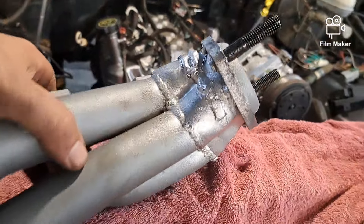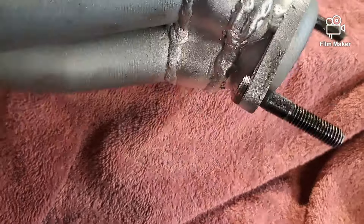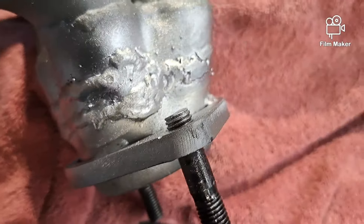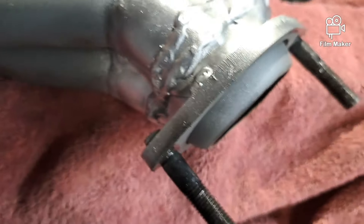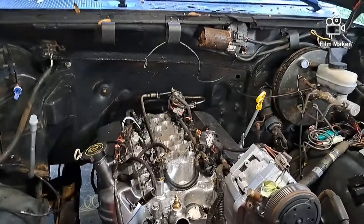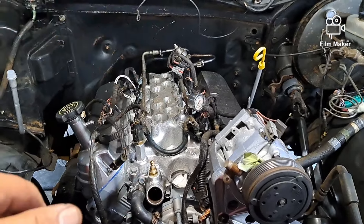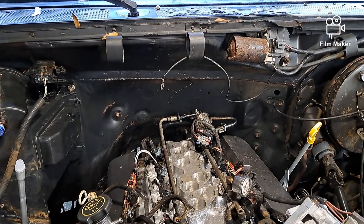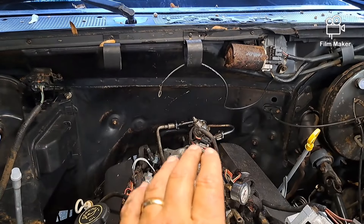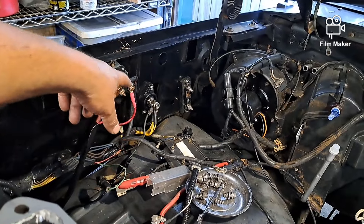I did get this done — still light out. This turned out really nice right there, fused the metal together well. Over here not so much, but mechanically it's not going to come apart. Hopefully it's not got any leaks — I shone the light in there and can't see any light trying to get out. I tried to put the upper on after getting the harness on and all that, but the back of the bottom side of the intake hits the fuel pressure regulator. I think on the van the plenum is over on this side, and I want to have my air filter over here.